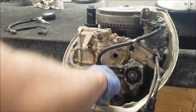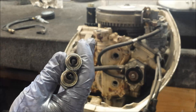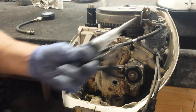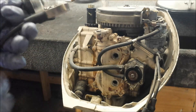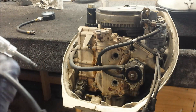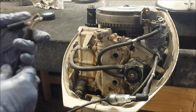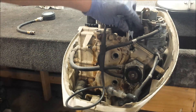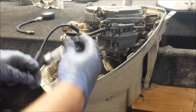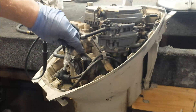See what she's like. Plugs, not too bad. So what I have is a spark tester — let me show you. That's the spark tester, that's a little adapter. One little marker on top cylinder. Let's clip this onto a ground somewhere — hope that's a ground. Hopefully you'll be able to see it light up. I don't know how I'm going to position it. Yeah, that should do it.